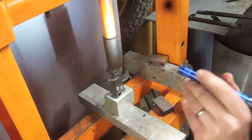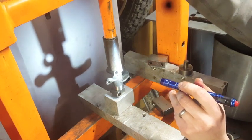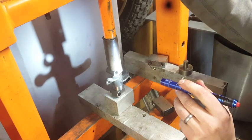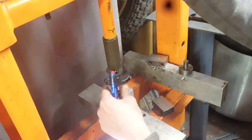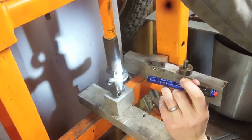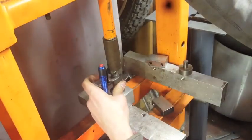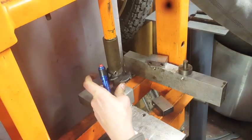This is where it gets a little tricky: I want to push this block down far enough so that I still have freedom of movement, but with as little up-and-down slop as possible. Freedom of movement is most important because when I install the rocker, I'll have the ability to micro-adjust the distance between the blocks to eliminate any end float when the bike is running — that's one of my top-end adjustments. I go slowly and get as close as I can without going too far. The movement can sometimes be smooth, sometimes a little jerky, so you do a little at a time.